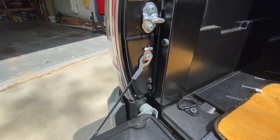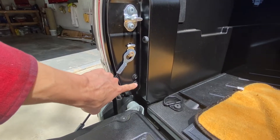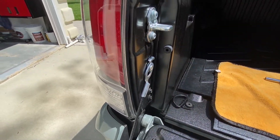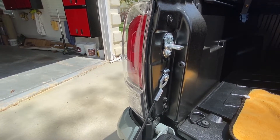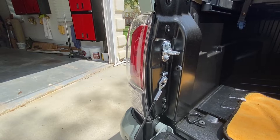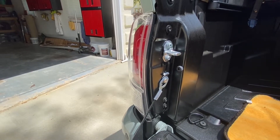The removal of these OEM taillights is relatively painless. You've got two 10 millimeter bolts — one right there, and one right there. We'll use our 10 millimeter ratchet to remove those bolts. Once those two bolts are removed, this thing will feel loose. There are also two metal pins that go into the bed — you'll pull straight backwards and the taillight should pop right out. Then we'll disconnect the electrical connectors on the bulbs. Let's go ahead and take those two 10 millimeter bolts out and pull this taillight out.